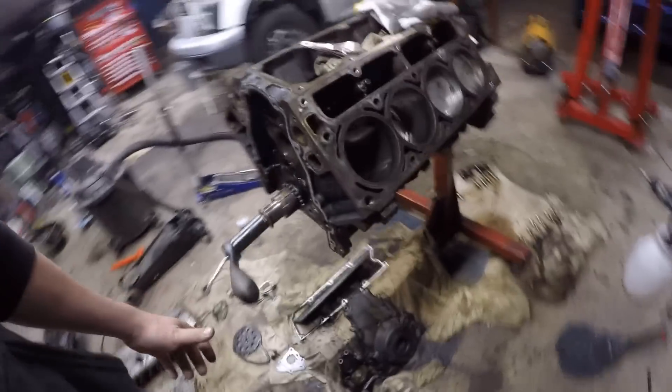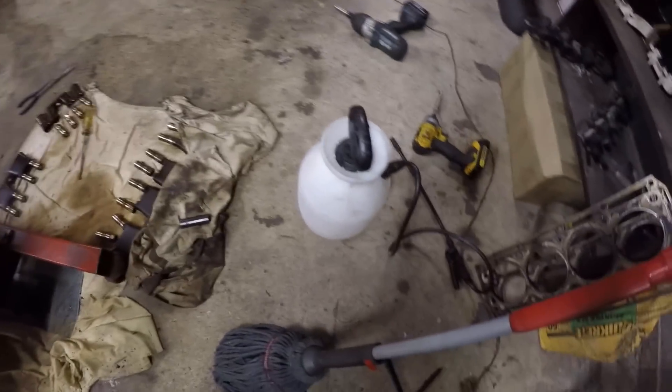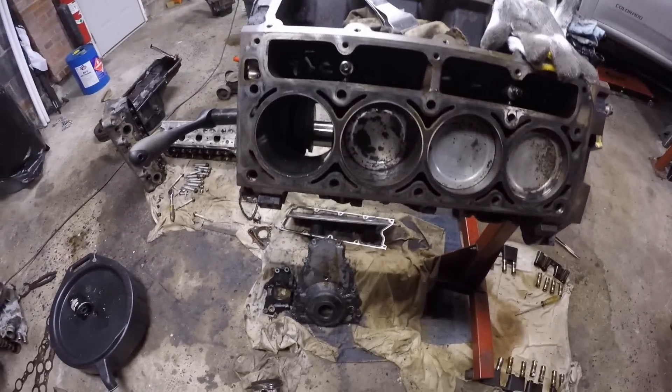Anyway, we'll stop saying cake. That piston's pretty clean too. My last resort was I actually put diesel fuel in my sprayer, like a weed sprayer, and hosed this thing for like an hour or two with diesel fuel.